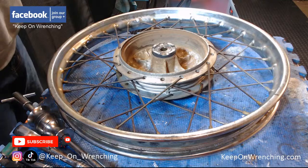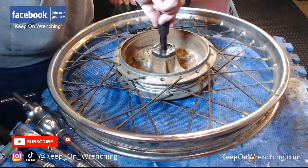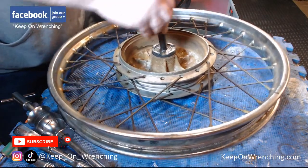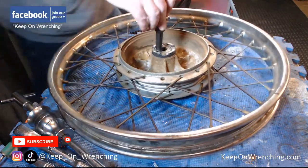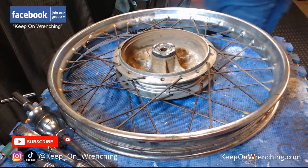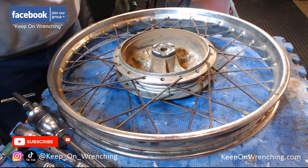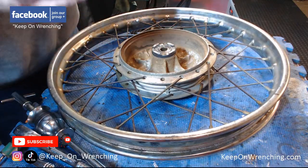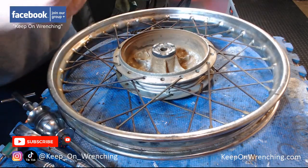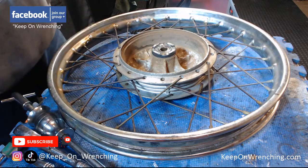Yeah, it's a slide hammer puller, but I've also heard them called blind bearing pullers. So I think either one is going to be good. We can call them whatever we will. I call it a miracle tool. This one's a little bit too big for the job. So I can go over to this one, and hopefully we can expand this one just enough to be able to pull this out. And again, the thing just tightens up and it should expand. And hopefully we can get that to expand enough to where we can get it going.